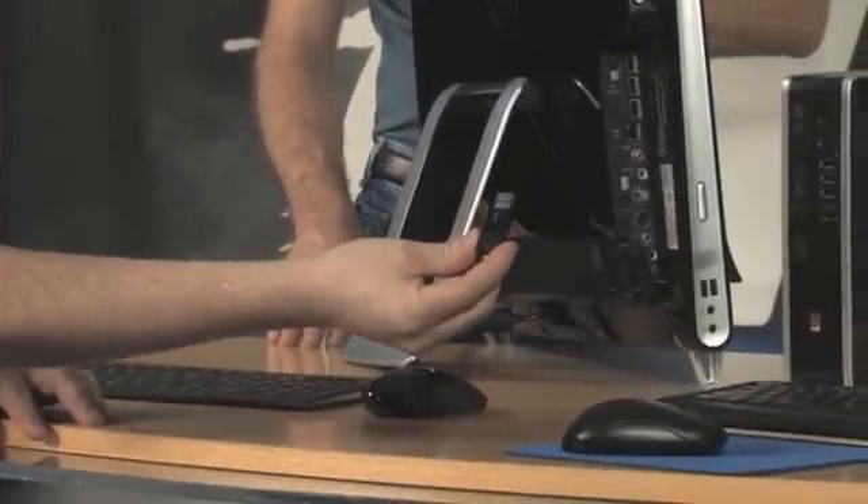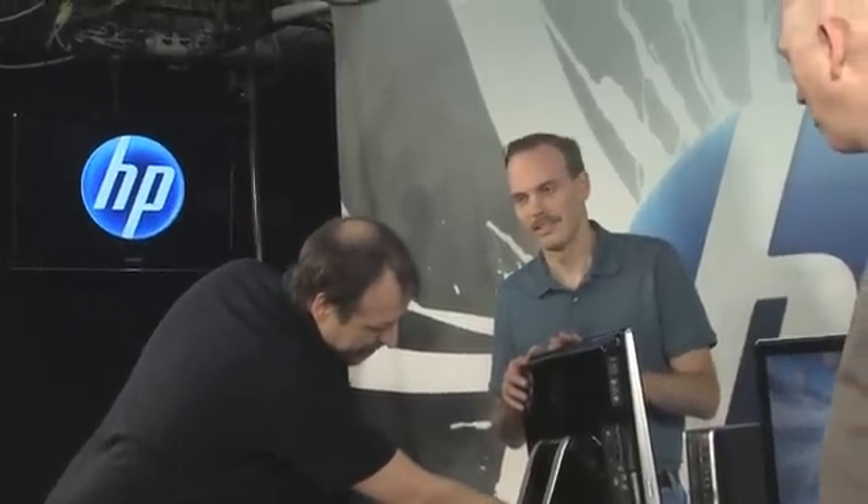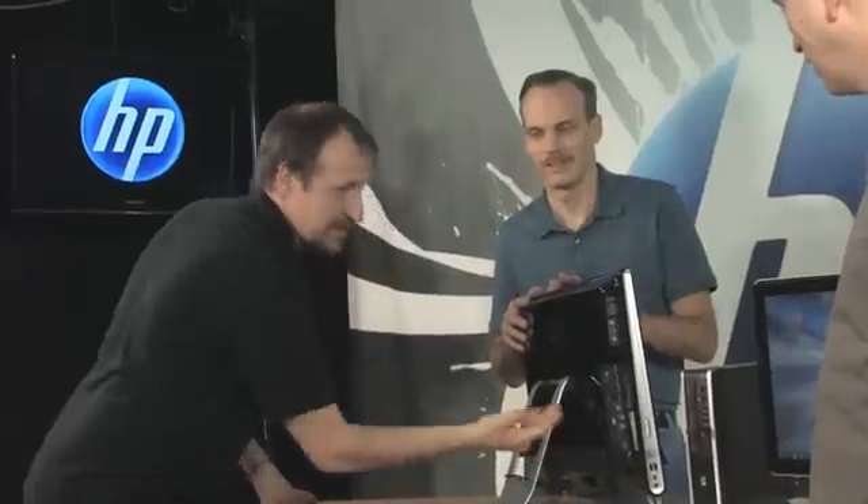What you can do is plug it into one of the side USB ports to make sure it's synchronizing, especially when troubleshooting. You want to eliminate variables — if it doesn't work in one port, try another. You can reseat it back in as well; it's not very difficult. Now they're all talking together, and that's what makes them run. Thanks, Bill! See you around.